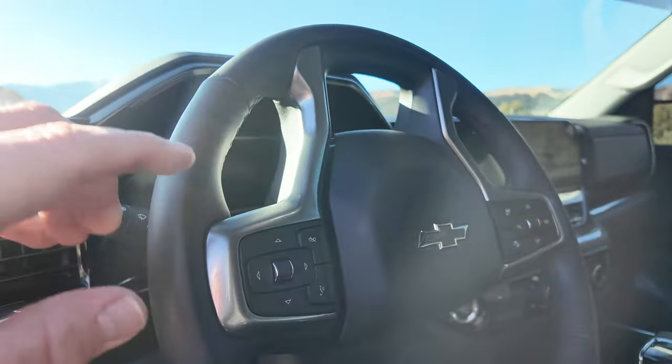So, anyways, this is a good truck. I think if you're in the market for a half ton truck, you've got to check out this diesel motor. GM should be on your list, and I know a lot of people side in the camp of the V8 for towing. You know, the 6.2 liter has a lot more horsepower and similar torque, but the torque at low end and keeping the RPMs low on this Duramax, I think it's worth looking at and shopping it before you make a decision, because it's a smooth ride, it's a good towing motor, and you get that power, you get that torque at lower RPM, which is nice when you're towing as well, to get that power earlier versus having to wait for it to get up into the 4 and 5,000 RPMs on some of these trucks.